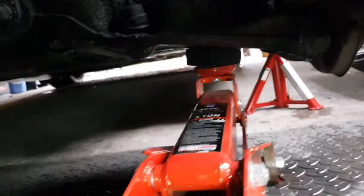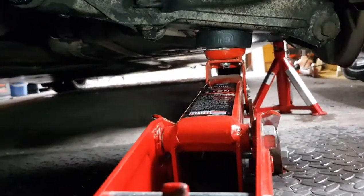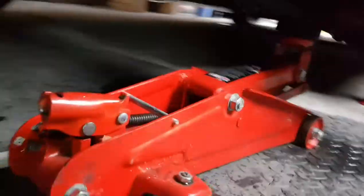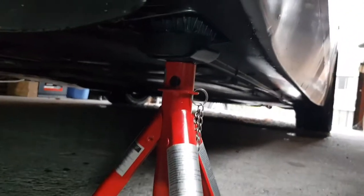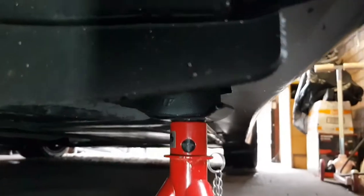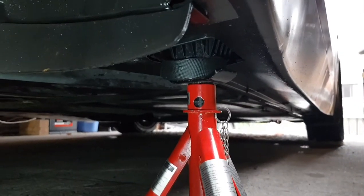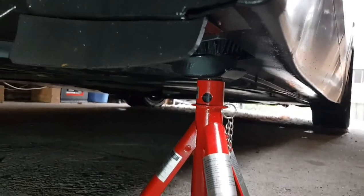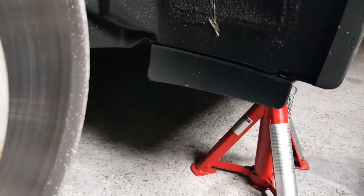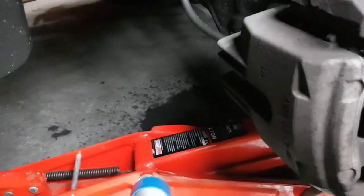Before I actually carry on, what I'll show you is I've just lifted the car up. There's a little control arm there, essentially, with a jack — that's just a hockey puck there in between the two to stop any scratch or damage. And then set it down on an axle stand here, again with a hockey puck in between the metal and the jack point. Just to make it nice and secure — this jack isn't holding anything now, the whole weight of the car is on the stand, this is just hovering slightly below the arm.